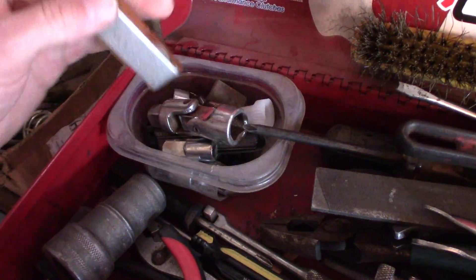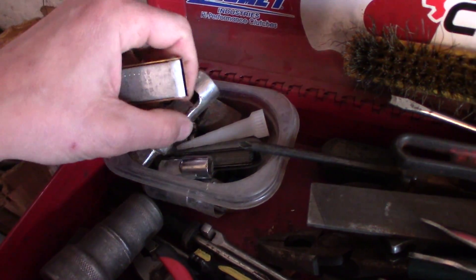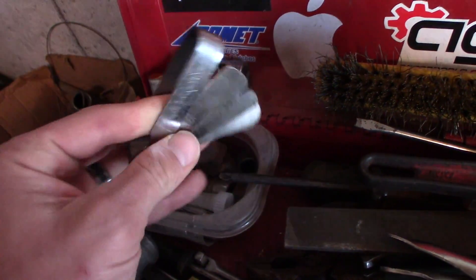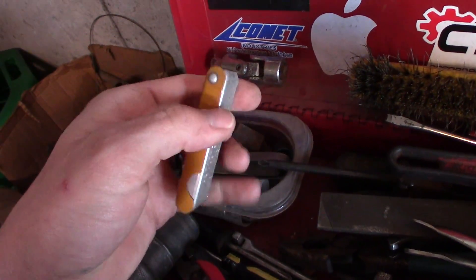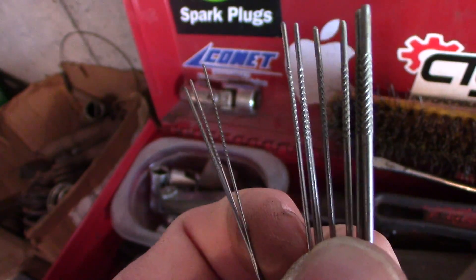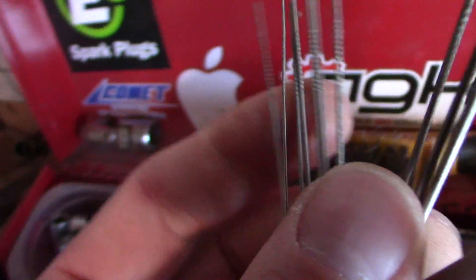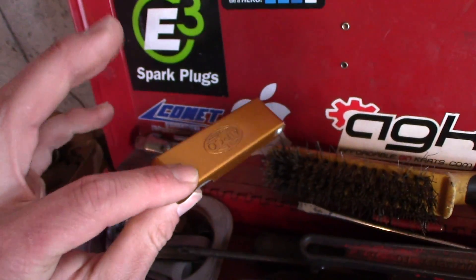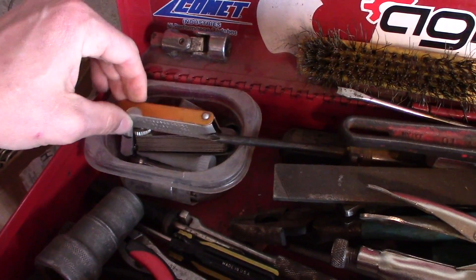Over here I keep this little dish of small adapters — there's some swivels and stuff like that. You definitely need one of these in your toolbox: this is a feeler gauge. Another one you probably shouldn't live without is a torch tip cleaner — basically like toothpicks ranging in sizes. These are great for cleaning out carburetor jets and ports. There's really no reason to not have one; they're insanely cheap. You might as well buy a few of them.